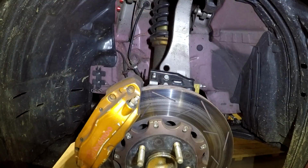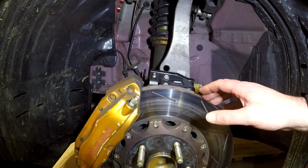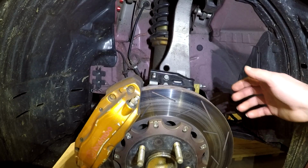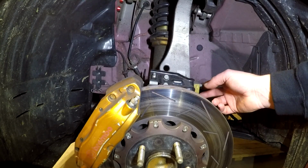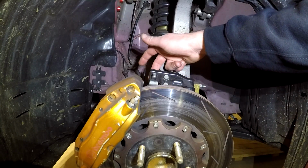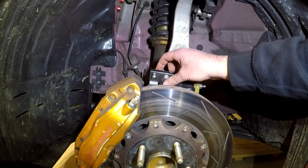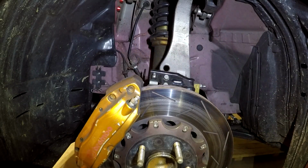After removing the wheel, we need to start preparing to remove the brake caliper so we can remove the rotor. If you have OEM style Brembo lines, i.e. two-piece lines either from the factory or the braided stainless ones like Z1, you do need to remove this bracket as well as a bolt here on the back side. These are all 12mm fasteners. I'm going to go ahead and remove these, and then we'll work on getting rid of the caliper.